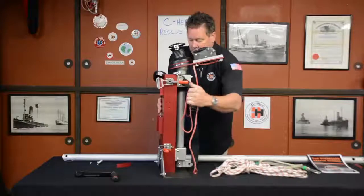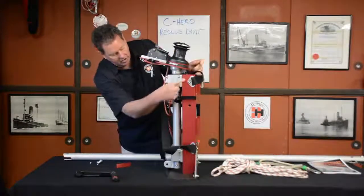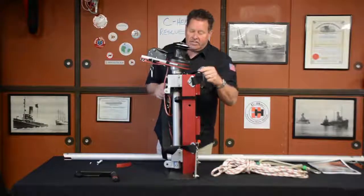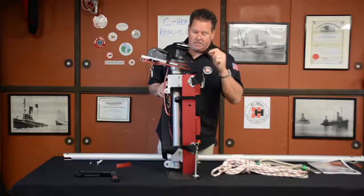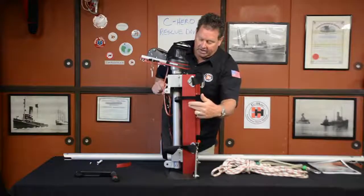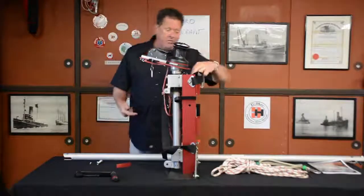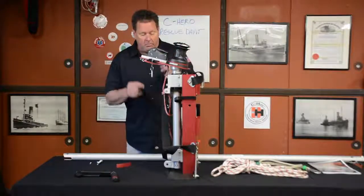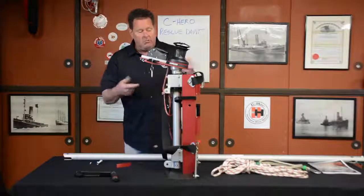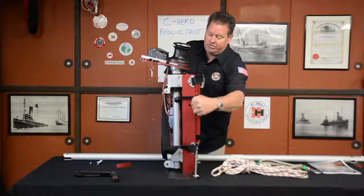On the other side, the dead-end side of the strap — if you're going to move this to the lower spot, you're going to use a 5/16th Allen and a half-inch box wrench inside here. Take it off and put it back down. The pro tip on that: when you go to put it in, your hand won't really fit inside here very well. So put a piece of duct tape over the box wrench, put the nut into it, put it down in the channel, and thread the bolt to it.